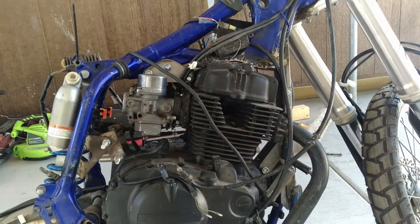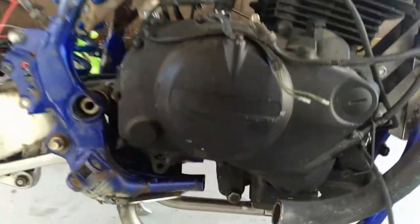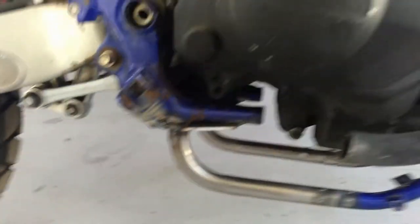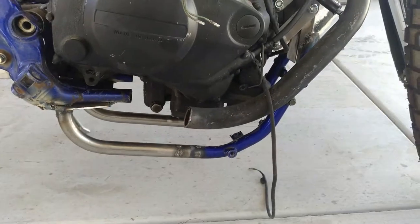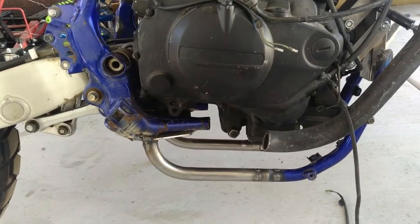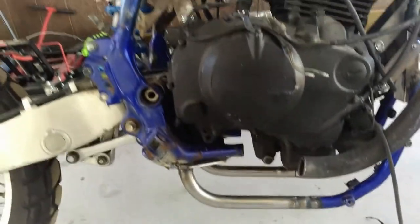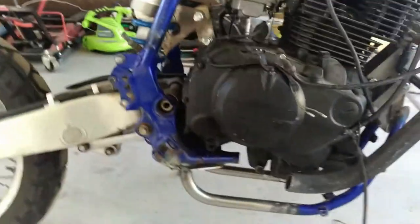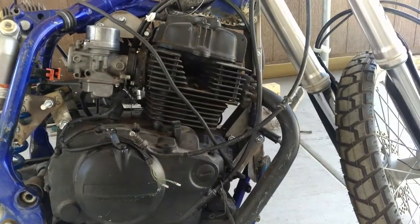The color scheme is going to be Yamaha blue and black, I'm not too sure yet. Most people are probably wondering why I didn't cut that off - we left that on there for strength. Once that plate on the bottom is welded in completely, it's going to make that incredibly strong. We're going to be bolting the belly pan and the down tube in, and it's going to be just as strong. I want some assurance that in case a motor mount breaks, this engine is not going to fall out of this bike entirely - it'll be held side to side no matter what.